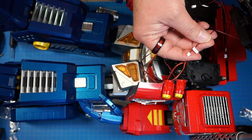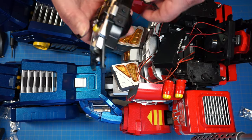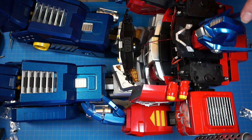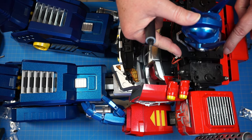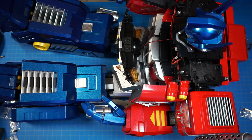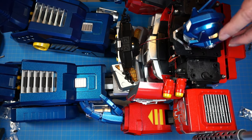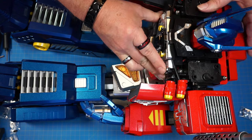Let's plug the cables into the head — we've got one, three, and four. Now we've got the matrix here and that's number two. We've got to get all of these pushed back in here. We've got two 2.3 by 6 and four 2.6 by 6 screws for screwing this down. The 2.3 by 6 go right here and here, then the others go on the side. Get the smaller ones put in first, then the larger ones. Let's get those screwed in.